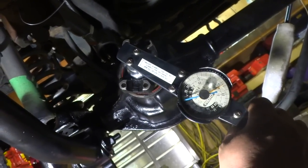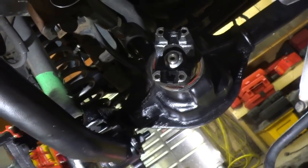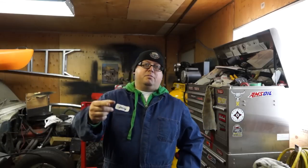I'm going to check my backlash now and then check my gear pattern. Once you have your pinion preload set up properly, remember there's a difference between using the old bearings and the new bearings as far as preload. Not only after you have your preload set up on your pinion, you've also got to have your bearing preload set up on your differential — and that's going to be a whole other story. All those have to work together in order for the differential to be set up properly. That's going to be covered in different videos. If you have any questions or comments, post them below. Thanks for watching.